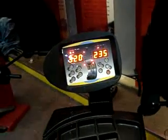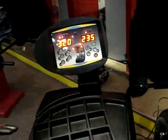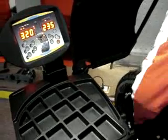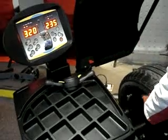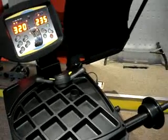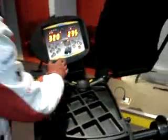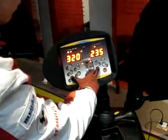Okay, we exit. Now what we need to do, we need to remove the wheel and to perform the machine calibration. Okay. When there is an error 001, a machine suggests to do OPT, and then that we take off the wheel, and then that we press F and number 3 button.